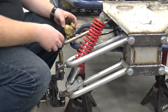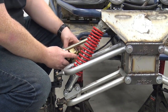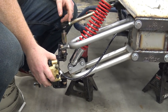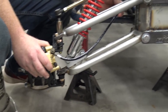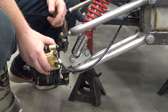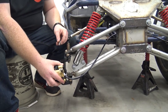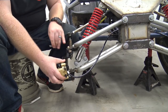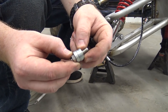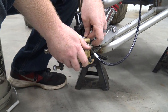I'm thinking the brake lines may go through here — it won't even fit through there actually. If I did it right here, that would allow me to bolt it up, and then I'm going to have to loosen this and adjust the brake line, then zip tie it to the A-arm and allow it to go through there. I don't have any bolts exactly the size I need, so I'm going to have to do a thick set of washers on these bolts — these are one-inch five-sixteenths bolts but I only need like a half-inch bolt, and that's all I have.